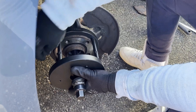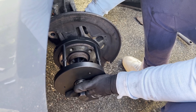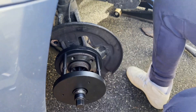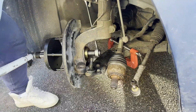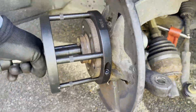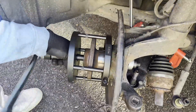So let's remove that bad boy. Place a 30mm spanner on the end of the tool and let it touch the knuckle — that way it can be a one person job. Now start ratcheting the front end. For that you will need a 22mm hex socket. I recommend using some extension such as a jack handle or a very long breaker bar. After you hear a popping noise, it should be easier to ratchet.